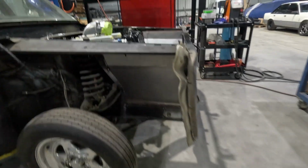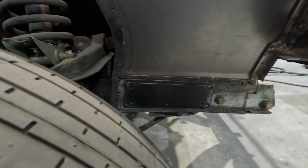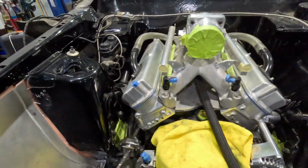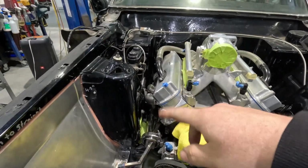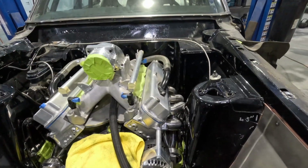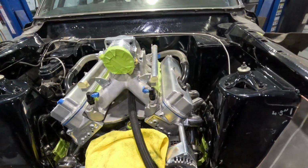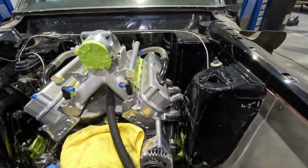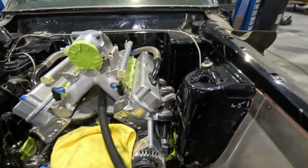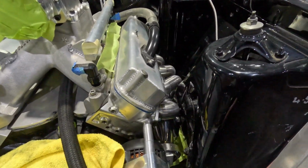with limited room. From the back side here, you'll see we'll put some plates down here to reinforce the rails. From here, we'll finish those 2 primaries on this side, and then whilst Will's fixing that side up, I'll start pulling the primaries off over here, heavy tacking them, getting them to a point where we can purge them, weld them up, one by one, put them back in. Once they're sufficiently welded, all done, we're gonna start doing all the intakes to the turbos.